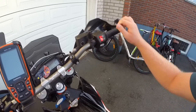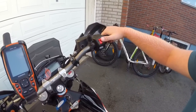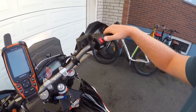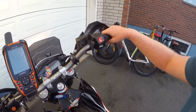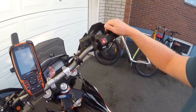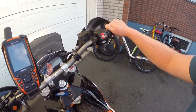For the second mode, you have to turn off the ignition and push the kill switch into the off position. Then turn on the ignition, push your kill switch to on, and start the bike. In this mode the bike will start with full ABS — you have ABS on the front wheel and ABS on the rear wheel.